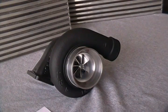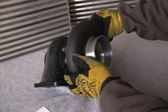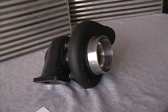Let's look at the power level and characteristics. A lot of the power and characteristics are very similar to that of the journal bearing Reaper turbocharger, except this is much more highly durable in terms of being able to withstand a bit more heat. The tolerances are a little bit tighter on the cartridge — everything you would expect from the GT35R, because that's where this turbo is based from. For 2012 and 2013, we noticed that users in high endurance racing with high heat transfer and high rotational speeds wanted something with better transient response.